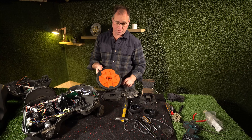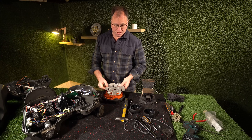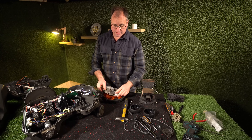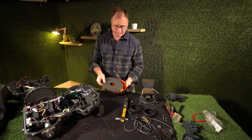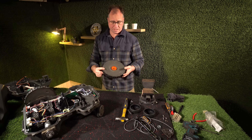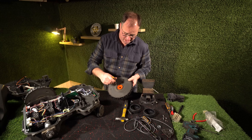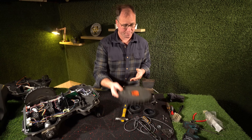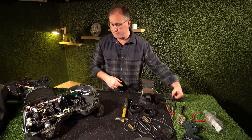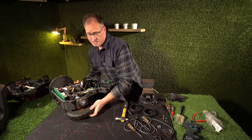So often when I service these I'll give them a gentle water blast. Likewise, both covers come off so you can give them a good scrub or use a scrub brush with the water blaster just on gentle. They just click back in there. To locate that you just spin it around and you'll feel it locate in and you're good. So when cleaning these you want to scrub all around here because that debris is going to build up and rub on the outside of your wheel motor there.